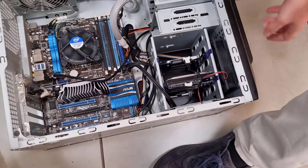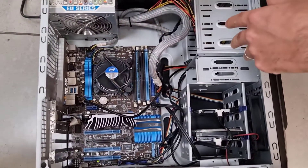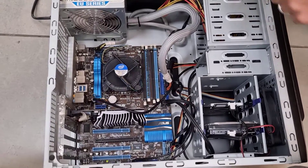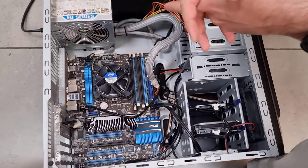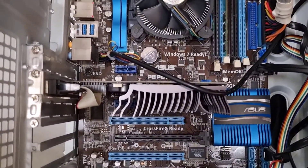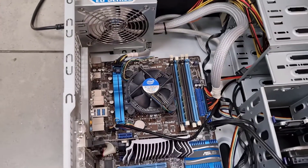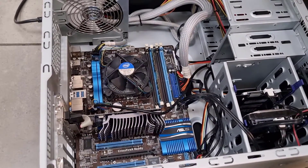As you can see, the fan is running, the power is on, but there is no start beep and no other activity. For your information, I ran some tests to look into the problem. I have replaced the graphics card, replaced the RAM module, reseated the CPU, and I confirmed that the CPU is warming up when started. So everything looks okay there.